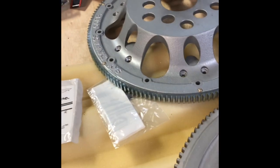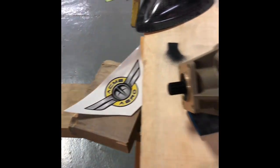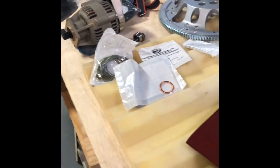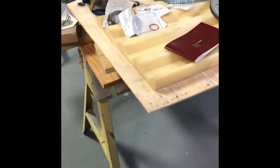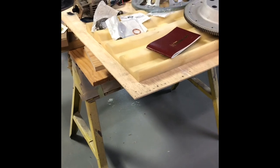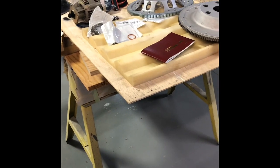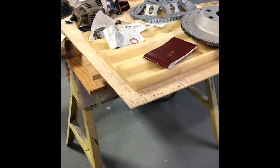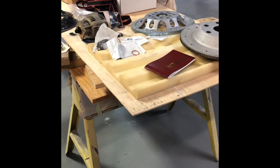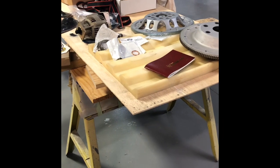The reason I mentioned no pulley is I'm going to run the alternator off the back pad. Running one that way, that particular unit is 5.75 pounds, and if you weigh the one on the back with the belt and brackets you're right at 7 pounds, so you're saving a little bit there too.